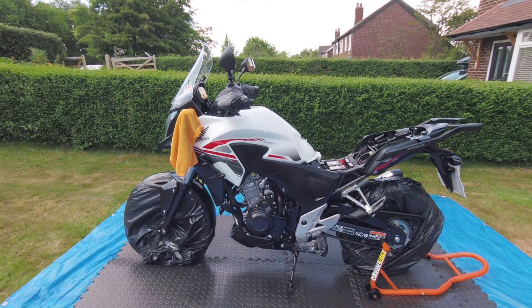Right guys, it's been nearly 15 minutes. I'm just going to go over the bike with a paintbrush just to push the ACF50 into all the hard-to-reach areas, particularly on the top where the electrics are, and maybe underneath a little bit where the engine is as well. Once I've done that I'm going to go over with a cloth and then turn the bike on.